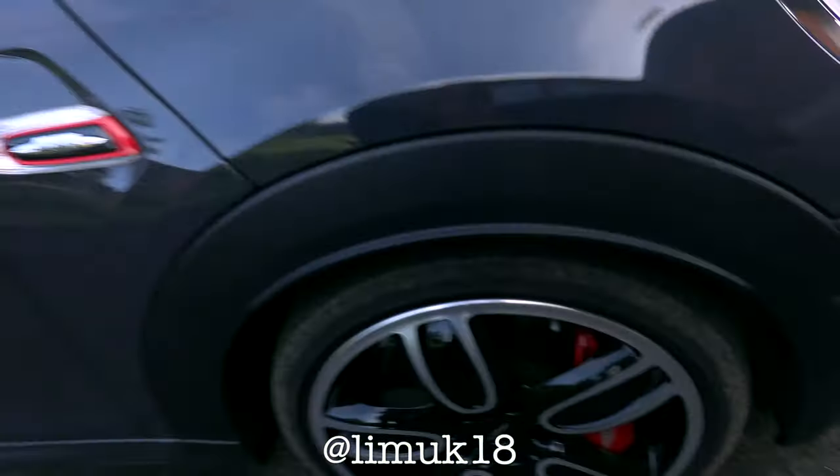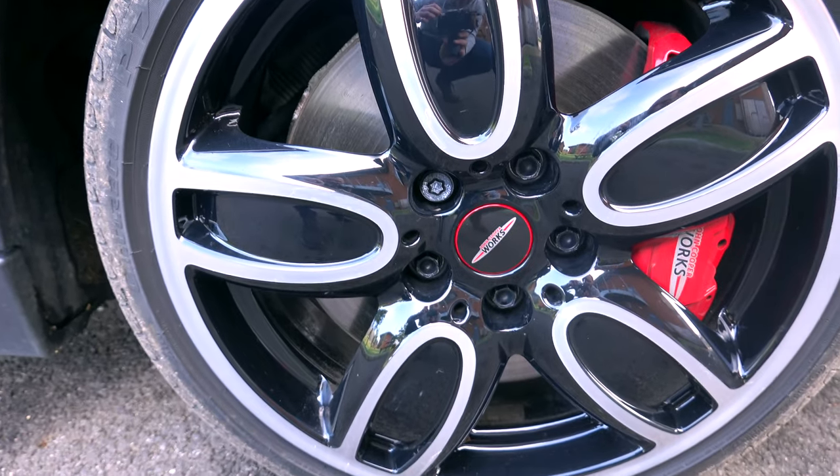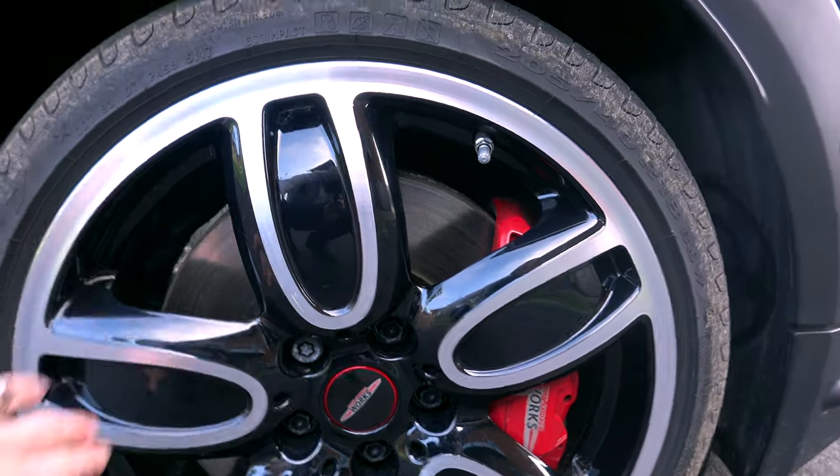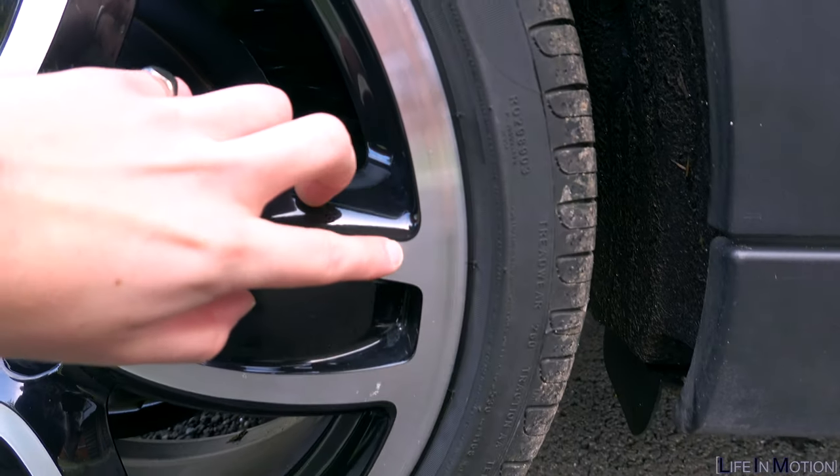First thing first is the wheels. You can see on these wheels that they look pretty much brand new — they look great. But if I go back to this one, can you see it's kind of going all a bit white? That is where I had a refurb on the wheels. There's nothing wrong with the refurb if it's done correctly, but sometimes if the lacquer on top is too thin, water gets in and goes all kind of white, exactly like that. If you are going to look at a car that has had a wheel refurb, just make sure you check whether you have a warranty, and also whether the job was done well, because you don't want to be four months into owning the car and have them go all milky and white.